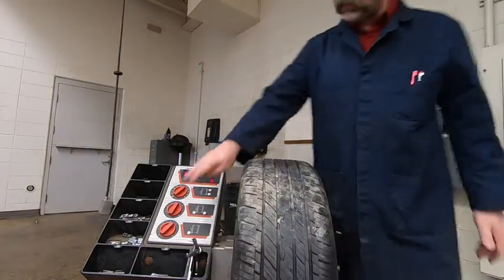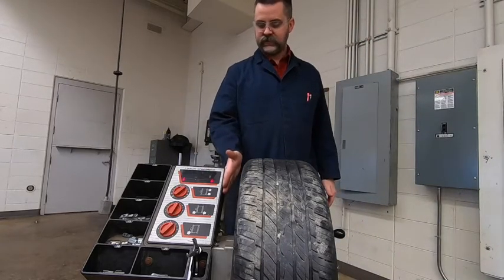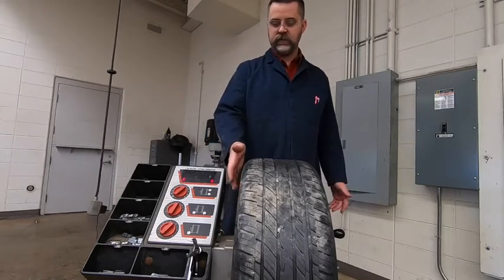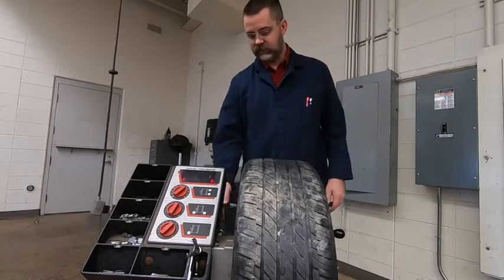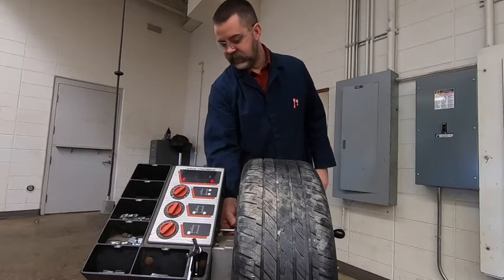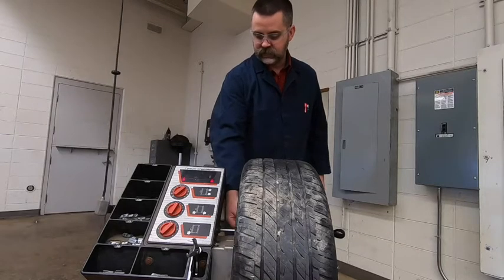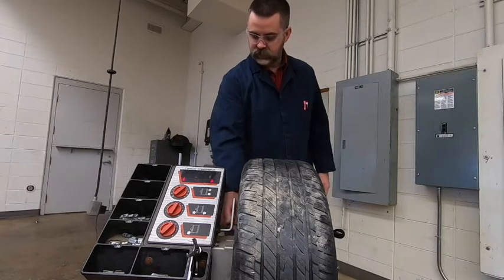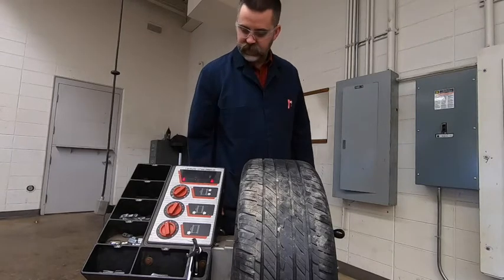We'll go ahead now, we've got our bottom dial to look at. This is, again, the distance between this black surface and the inside of the rim right here, just where my fingers are touching, the same spot where we just took our measurement from, but on the inside surface. On the machine, you've got a little slide-out measuring device here, so you just slide that out until it's on that same flat surface that we just measured from, and it's got readings on here. We are at 4.5 inches. So we want to set our bottom dial here to 4.5. So we've got that at 4.5.